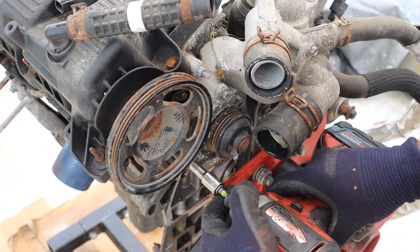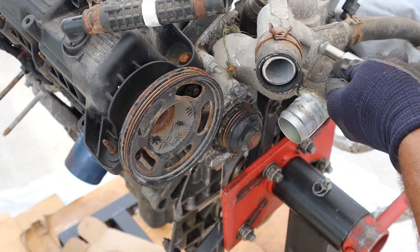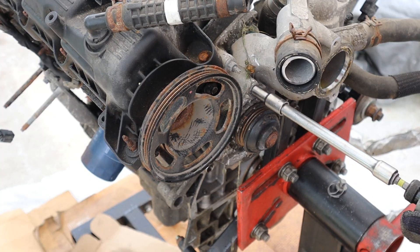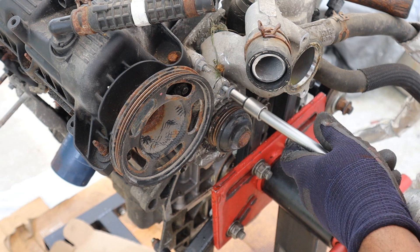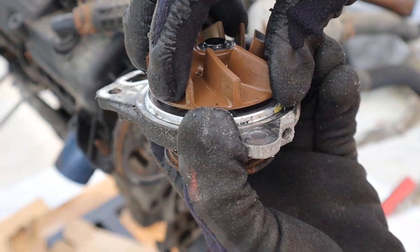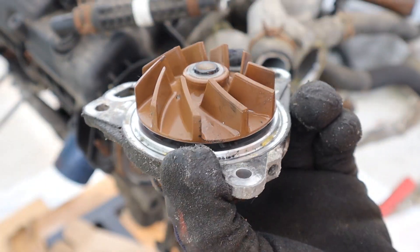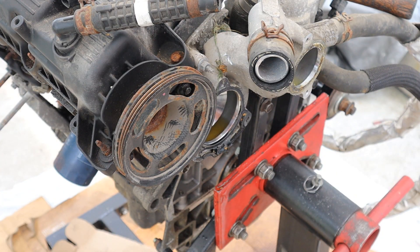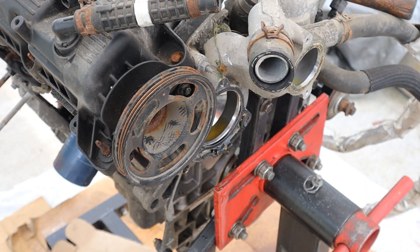Next I'm going to remove the water pump. That's actually the thermostat — at least it's made of metal. Here's the water pump. It has plastic impellers and has a very tiny amount of vanes, so it is worn. Accessing this part in the car with the transmission in the way is a little difficult, especially compared to the front of the engine.